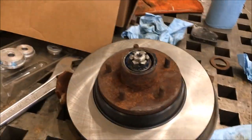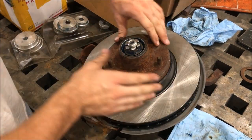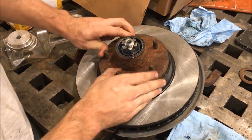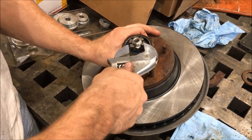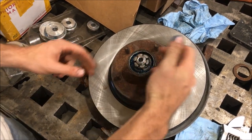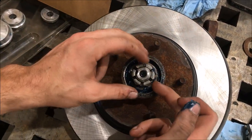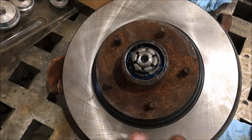With the bearing tightened down, when I turn it, it stops — there's not much more to go. You check it after 500 miles and call it good. Back the nut off, then tighten it back down finger-tight in the forward direction. I'm right here — the hole isn't lined up perfectly, so the next slot is coming up just a little bit farther. I'll turn it just a little bit more, put the cotter pin in, and that's all I need.